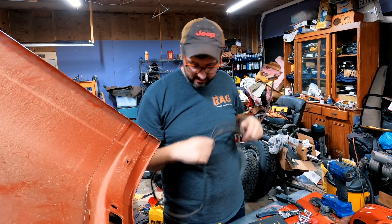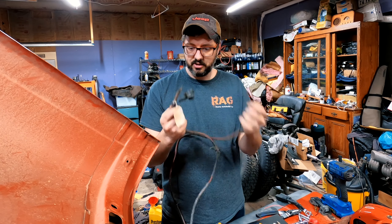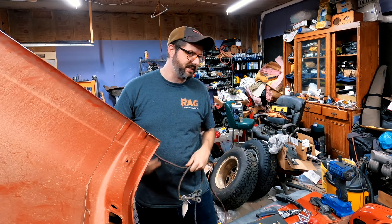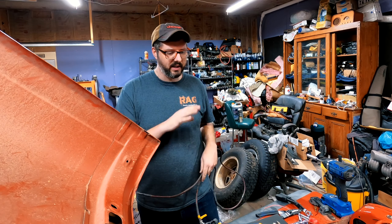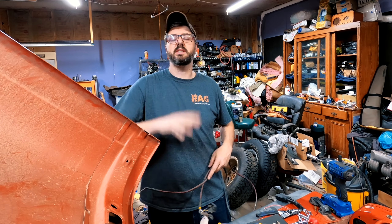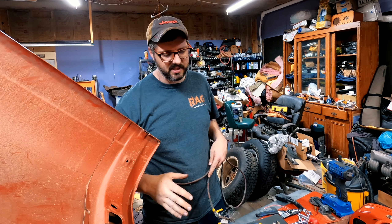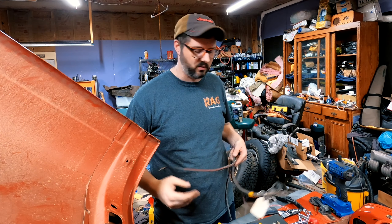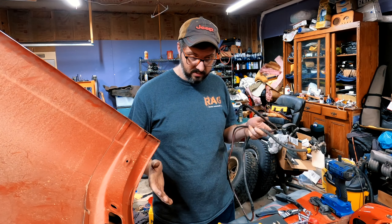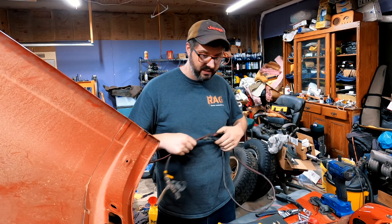Okay guys, the box is all wired up. Now all I've got to do is reattach the fried charging wire to the wiring harness. I realize this looks very haphazard, but there's a reason I've done it this way — I'll clean up the wiring and secure everything once I know everything's working. It doesn't make sense to put everything in its final position if you don't even know if it's going to work. So we're going to fix this real quick and then we should be able to see if the alternator is charging the battery.